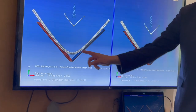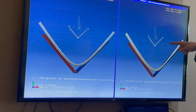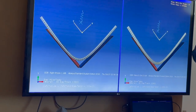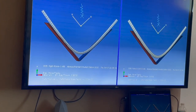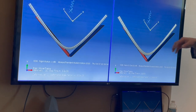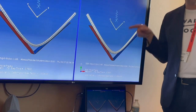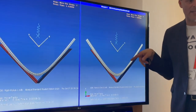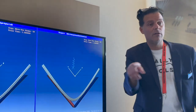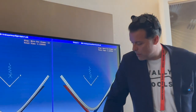This one's left, right, left, right. You can see this spring is very helpful. It's left, right, left, right. This one's going in an ovular pattern. Because of the zenith misalignment, it has induced a vertical excursion for the entire stylus, cantilever and cartridge motor, right? This induced vertical motion is why misalignment makes mistracking more likely. It doesn't make it happen, it just makes it more likely, because it creates a vertical vector force. So this is the cost, and this is very audible, as Michael shared earlier.